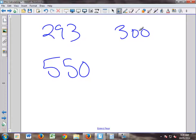You know how you said with the USB, if you only plan on using a couple, some people only put in enough wattage for what they need. So does that mean the other USB ports wouldn't work? No, they would, but I'm just saying when you're calculating it, calculate it based on what you know you're going to use, but realize that you're going to use more, but you're already adding a little extra, right? We don't say it's got 8 USB ports, so I'm going to add 24 watts. We just say I know I'm going to use 2 because I've got a mouse and a keyboard. That'd be the same as saying I've got a port for a hard drive, so I'll add another 25 watts. We're only doing it based on what we know we're going to use. That's a good question.